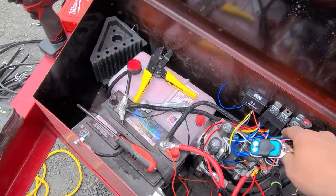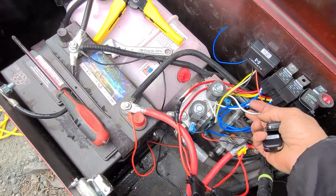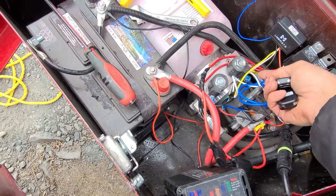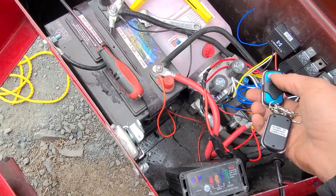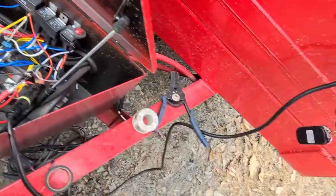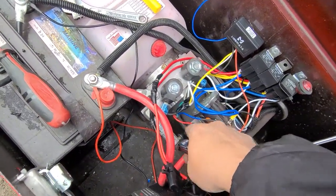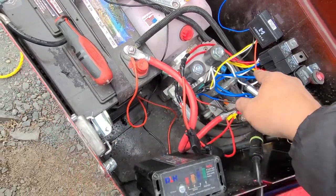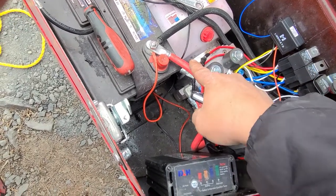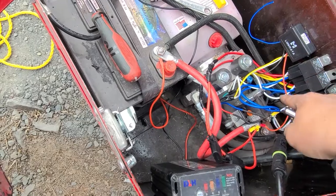You don't need to use diodes as long as you use two relays. The whites from the relay go with the white from the box, and the yellow is going to be the out — the in, which brings it down, connects to this solenoid. You keep the cord from the original box still connected. The white is your trigger, so this box triggers the relays to make the power go through the relay.